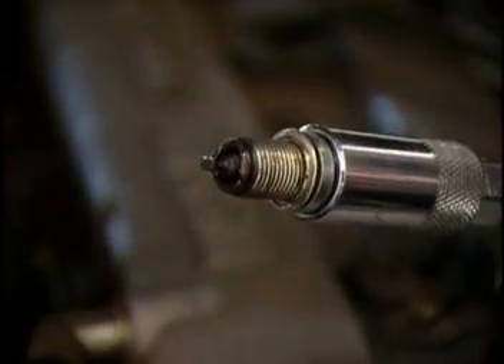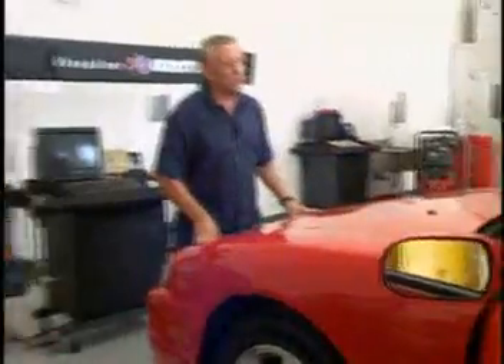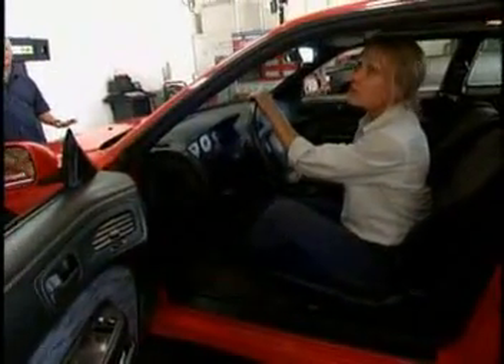According to this reading, I bet we've got a short — this thing's stuck open. How's that plug look? Black. Nasty — that thing's fouled. Let's pull this injector, get it replaced, put a new set of plugs in this thing, fire it up, and we're out of here. Instead of chasing around the engine compartment trying to figure out where to go next, the scanner leads us in the right direction. Like a kitten — got it.